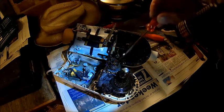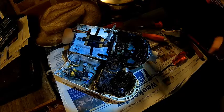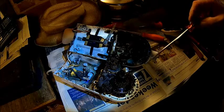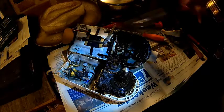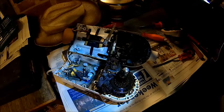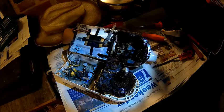The disassembly comes out somehow, I just need to get rid of all this old grease here. I'm fairly happy because the bearings are tight — I checked those, it's pretty hard to get it out, so the bearings are quite tight. There's not much wear in the metal parts, it's just a plastic gear which needs a bit of work. Obviously the whole thing needs a good clean, and then we should be good to go.